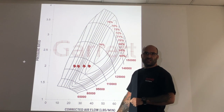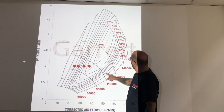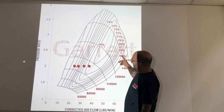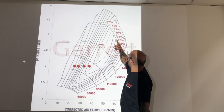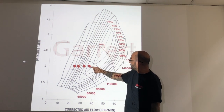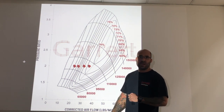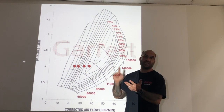Here is the G30 770 compressor map with the same RPM values. At 5500 RPM you're at around 60-65% efficiency. As RPM increases, at 6500 you're coming to about 65%, at 7500 RPM you're sitting at 70-71%, and at 8500 RPM you're at 75% efficiency — just outside the maximum efficiency island. We're not running high enough boost pressure to come into maximum efficiency with this specific size engine at one bar. Let's move on to the GTX 3582 Gen 2.